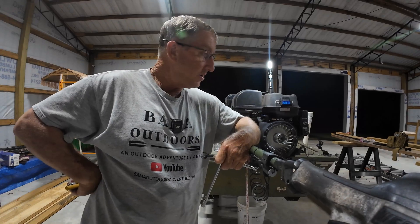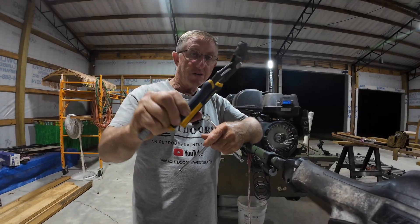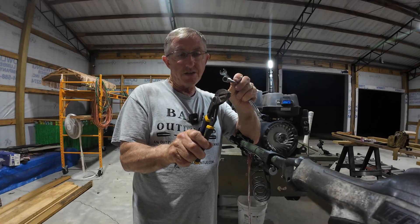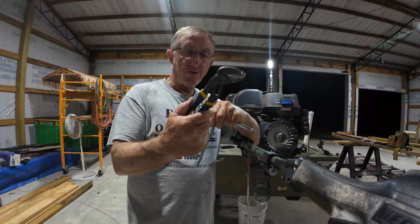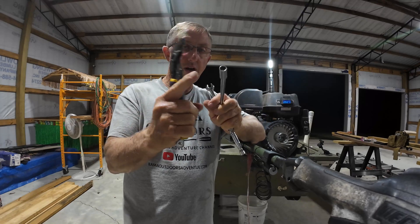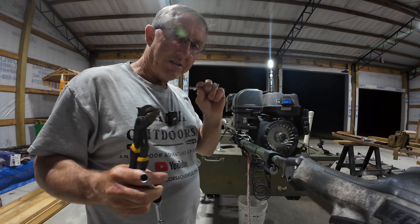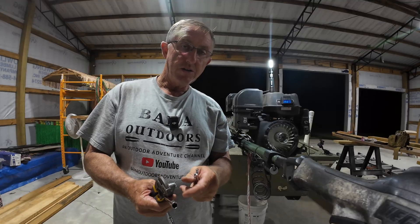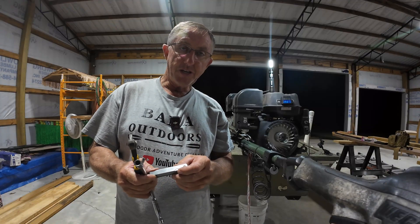Well, that's it — that's all there is. I hadn't been out here long at all; just even recording the video it might've taken me 30 minutes. It's basic tools is all you need. These pliers really come in handy the way you have to hold that little bitty nut on the end — you can kind of tell how far you turn it. You're just holding it while you tighten up the nut, so these are great pliers. I'll link them below in the description along with the feeler gauges. You need a number eight for the valve cover housing and number 10 for the little lock nut. Worked great, easy to do — so don't be scared to get in there and do it. They say it's good to adjust valves on a regular basis anyway, so get in there and get it done.